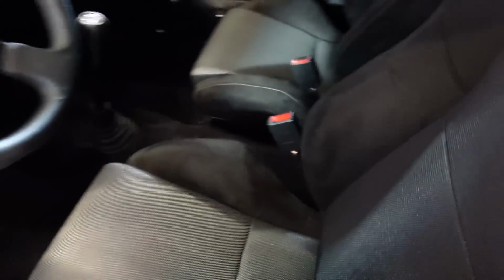Well, these gotta be the easiest seat belts I've ever had to put in. So, like I said, we got the little L bracket. I know it's dark in here, everything's black, but we got that little L bracket there, got the buckles bolted in, and I used all the factory holes for the actual belts. You can see right down here, factory hole in the bottom, factory hole in the side, and that is also the factory hole. And those are all braced on the inside, so those are very, very strong mounting points.